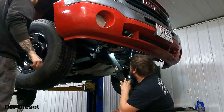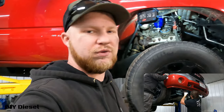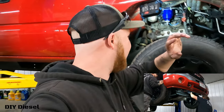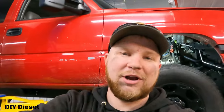We finally got it up in there. It's an easy job but just really tedious. Take your time, be patient, and be careful not to damage the hose when sliding it up in there. You're going to have some trouble with the idler arm brace — that's where it gets tricky. Try different ways to work it up in there. Now we're going to connect the hose up to the coolant reservoir, then to the heater core line, back to the radiator underneath, and to the bottom of the water pump.